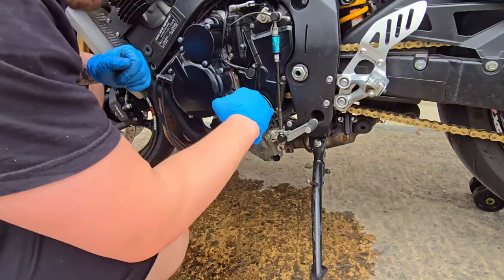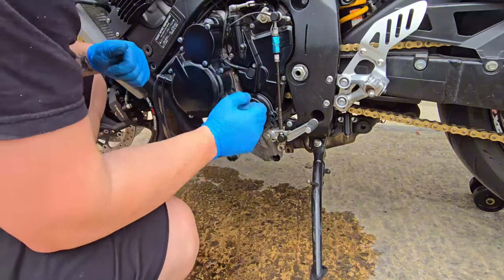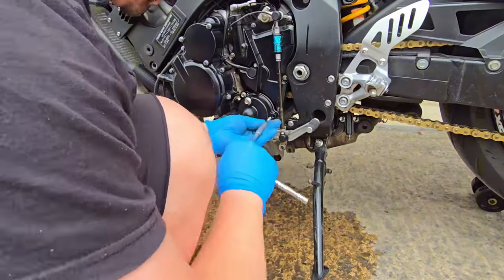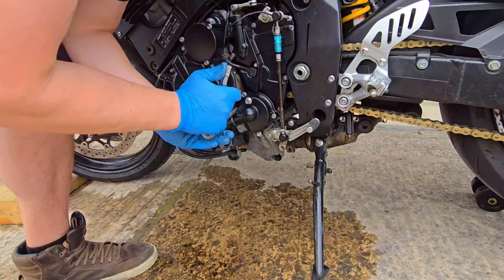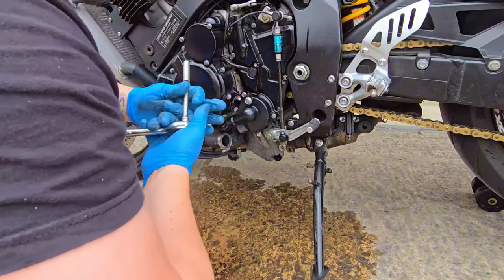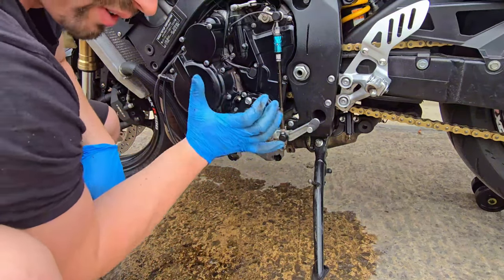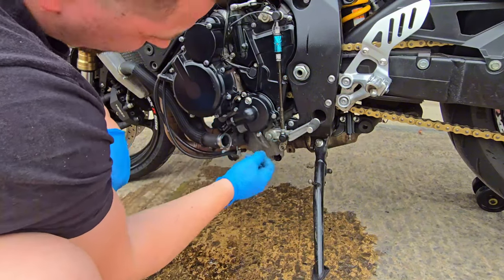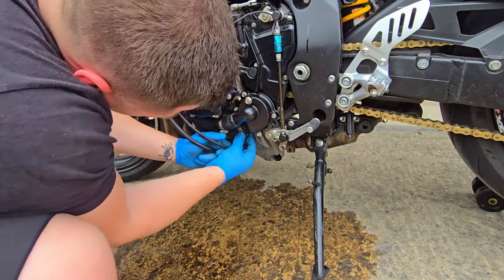That's definitely on now — you can see the edges have butted up into the face, so the shaft is completely engaged with the water pump. Going ahead now to put the original two bolts back in. If the shaft wasn't connected properly, when you start the bike up and put your hand on the pump and it feels cold, that would tell you something's wrong. I'm pretty confident it's properly engaged — you can feel it by hand and you can see the faces are butted up against each other. Now pop the two coolant hoses back on.